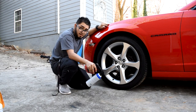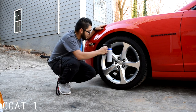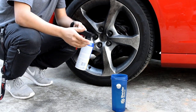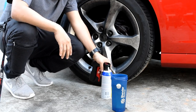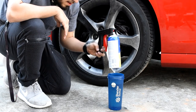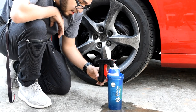We're going to spray a light coat — it's going to be our first coat. We wouldn't want to make it that dark; we just want to prep the tire for the next couple of coats. So you're going to want to shake the can really good, then go ahead and apply the first coat. We're running into some problems because it's a little cold out here. The plasti dip is not coming out of the spray can the way we want it — it's coming out spotty and causing issues. So we're going to put it in a cup of hot water if you're trying to plasti dip your wheels in the cold. This will be a very good method to get the plastic inside nice and warm so when it comes out it will come out consistent versus spotty.